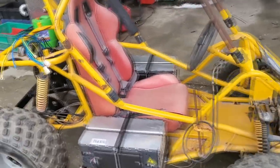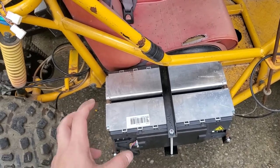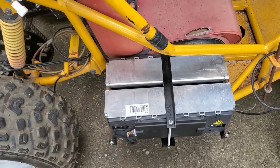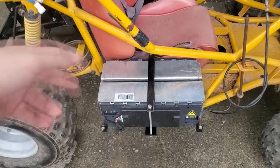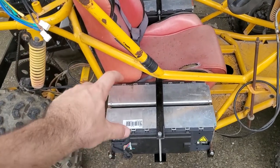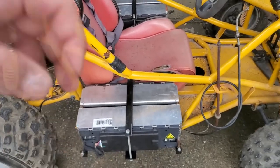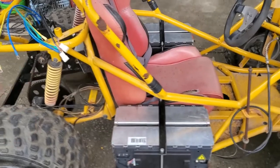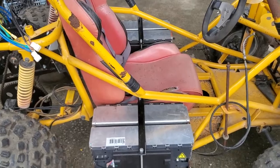So what have we done so far? These battery cells have a lot more energy than the ones I installed in the go-kart. These are slightly longer, so there are several more cells. It's 60 volts and 50 amp hours and we've got four of them. Two of them connected make 120 volts, and we've got them in a double parallel configuration to increase the amp hours capacity, so we have more range as well as less stress when we pull power from the batteries.